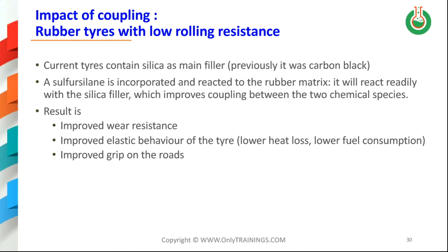Also nowadays, the grip of tires has been improved just by changing the formulation and introducing silica as the main filler. In fact, tires are still black, but that's just a demand from the market — no one wants green or blue tires on their cars. The carbon black that is used is just a pigment; it's no longer a filler.